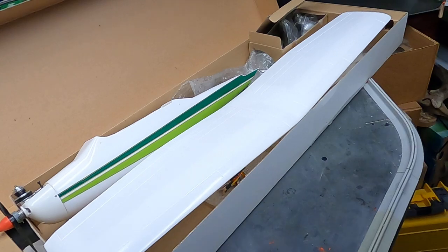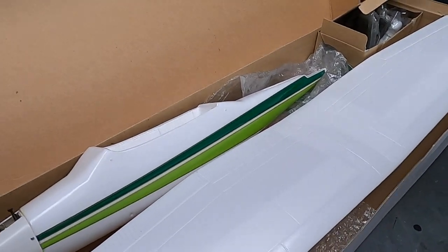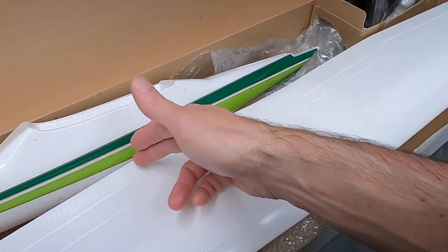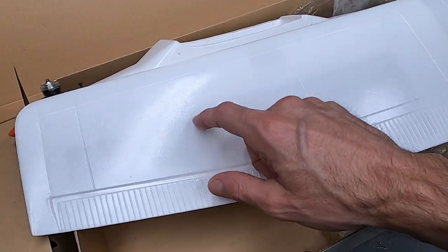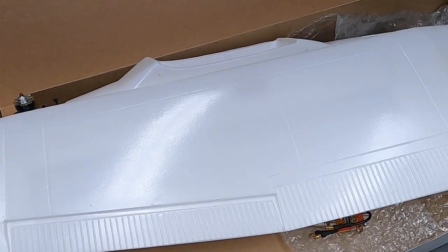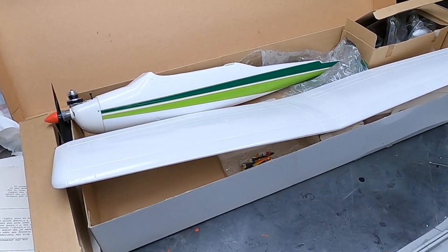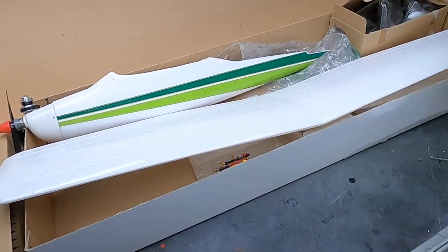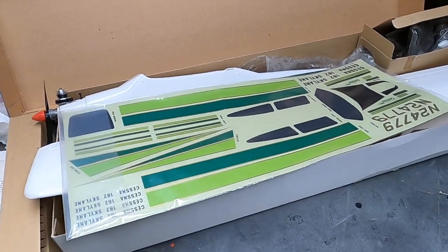I just wanted to go back to my roots and do a project converting this to a brushless plane. I'll have construction videos posted where I get the wing cut and fixed, the aileron installed with servo cutouts - I'm going to use micro servos to keep the weight down - and then we'll make it a full four-channel airplane as opposed to the two-channel it was originally designed as. Hopefully you enjoyed this video - lots of unfinished projects, but subscribe if you like my RC stuff.